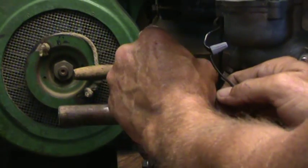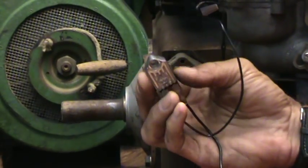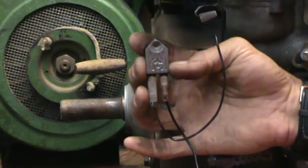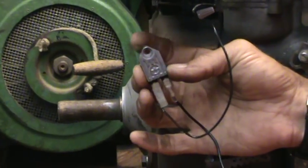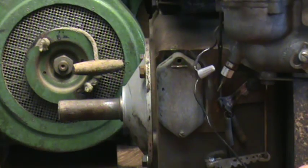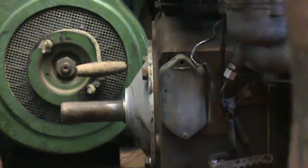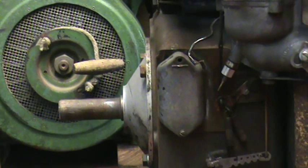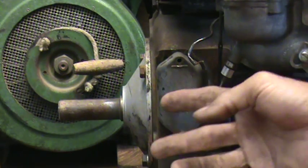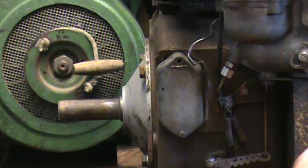And you have your Nova 2 mounted and ready to run your engine. It's just that simple. Plus goes to coil, negative goes to ground — that's how you install an ignition module. These are made by Stens. You've got Nova 2's, a bunch of different manufacturers. But they're all small engine ignition modules that eliminate points. Very handy. It's not something that's stock on a Briggs, but within just a couple of minutes you can throw one of these Nova 2 ignition modules on if you're having problems with spark, and those problems go away. This is Zippo. Later, I'm out.